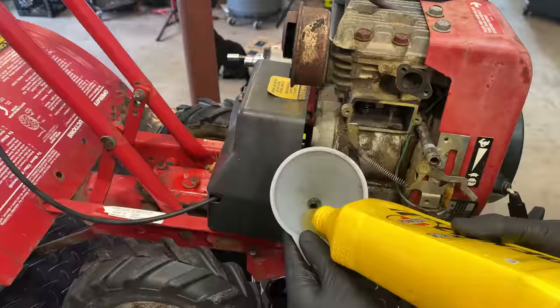You know, I think the only thing that's a little bit off is this choke lever. And actually, the whole plate moves around quite a bit. You know, I don't think that's a showstopper, though. This should work. But I do have the clone here. And there's a couple things I like about it. The main jet is fully adjustable, and so is the pilot. So it is a clone. I'd say it is a gamble, but it has some nice features. So let's give this one a try. And if it doesn't work, we got plan B.